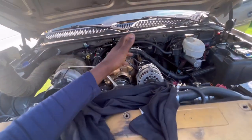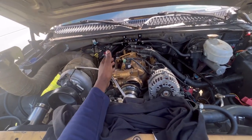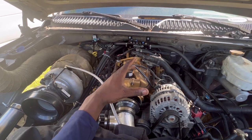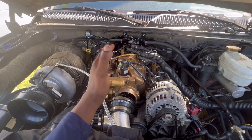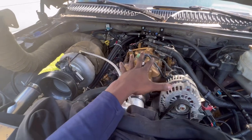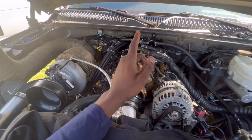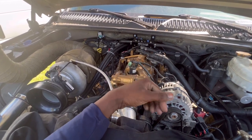I think I'm going to need a tune regardless. I'm already talking to the tuner. The only thing I'm waiting for is the injectors to come in and the fuel pump, getting the fuel pump from Racetronics. So I already got that area cut open so I can go in and change that. And the fuel injectors I got coming from LX Acceleration, a company out of Tennessee. The guy recommended these injectors. We're getting a 2-bar map sensor. So 50 pound injectors, a 2-bar map sensor, and then the Walbro fuel pump. You also got the wiring kit for it.